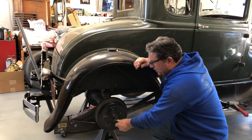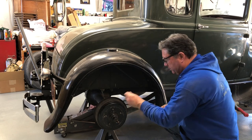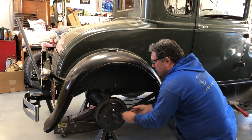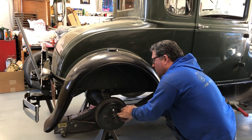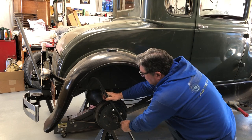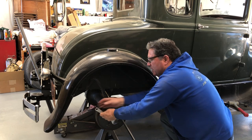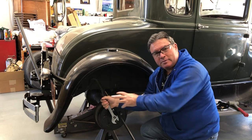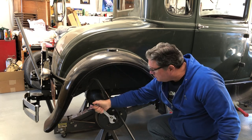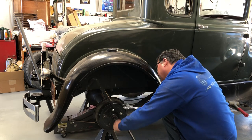It still turns. Now that everything is cleaned up, I'm going to put this hub back on. I've got a new washer in there and I'll get the castle nut on. I've got a cool way of tightening these because the problem is this will just spin — and this is a patent pending method. Just put a couple of lug nuts on so that you don't damage the threads. I'd rather damage lug nuts than threads — they're easy to replace. Then get the Tonya Harding 4.0, put it in there, and now you can tighten on this thing all day long and it will not spin. I get asked why I'm always using cheapy tools or adjustable wrenches instead of the right size socket. The reason is these tools were handed down to me by my grandfather and they worked on Model As. All I'm doing is continuing the family tradition — you don't need special fancy tools to work on a Model A. Regular old tools work fine.